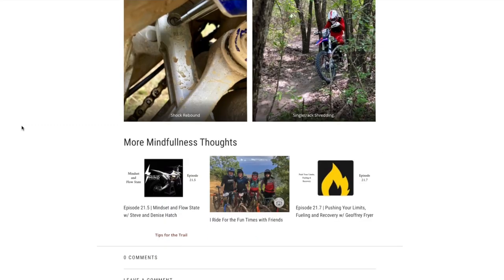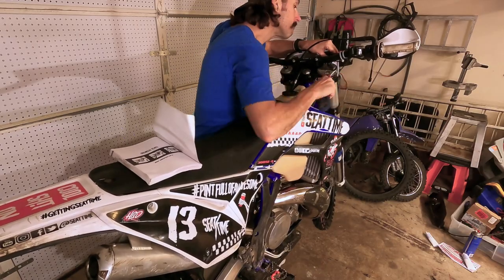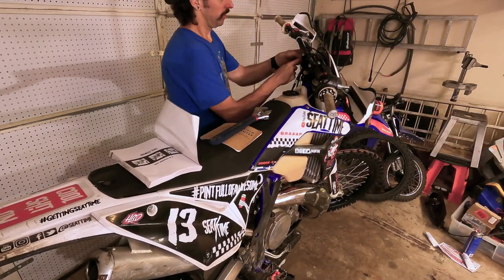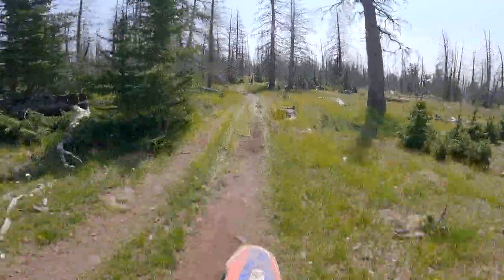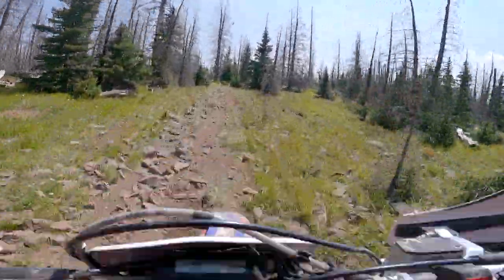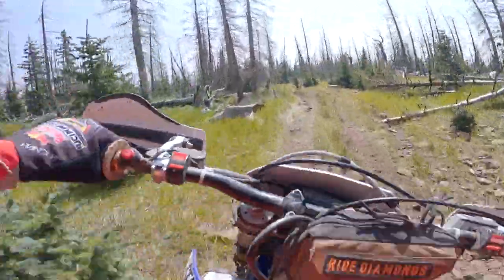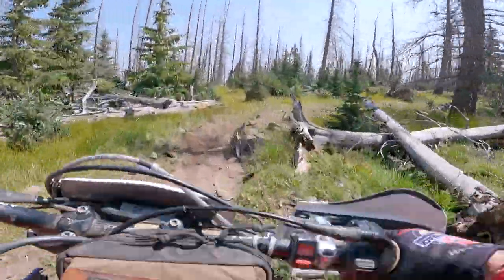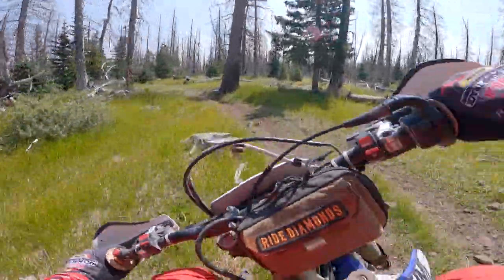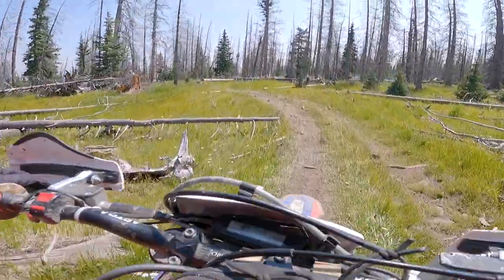I just released a post about resetting mentally and physically and getting back on the bike. To do that I reset my suspension, and now I've adjusted it again for Colorado: a little bit less compression dampening, a little bit less rebound dampening, and a little bit less preload on the forks. That way the bike can sit a little more in the travel and hopefully be a little more supple. I've had good luck with this bike before in Colorado, so going from those sport settings to the standard settings in the book will be a good place to start. Suspension done, jetting done, tires are on.